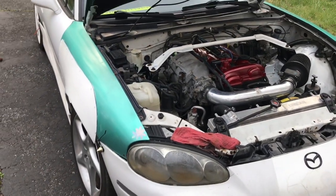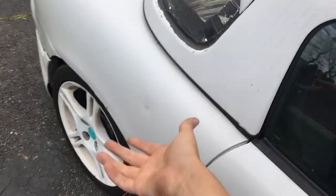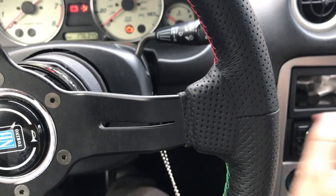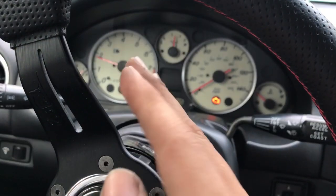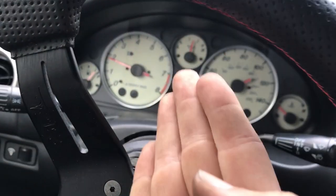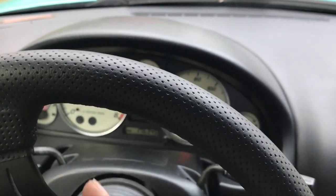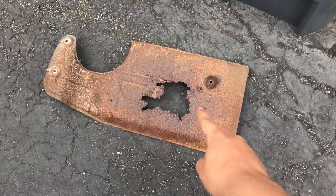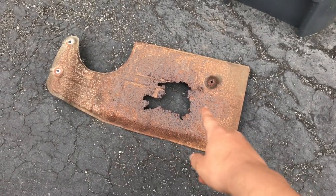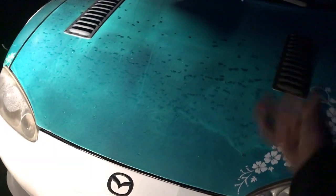Martha looks so good. We're gonna go for a little test drive to see if everything drives good or if there's any rattle. There's a little problem - she revs up at 2000 and stays there. Actually it's at 1500, but I'm pretty sure it's the mass airflow sensor - I just need to clean it or replace it. Goodbye muffler heat shield thing. We did the fuel filter, we took out that rear muffler heat shield thing. That'll be it for today - thank you guys so much, like and subscribe.